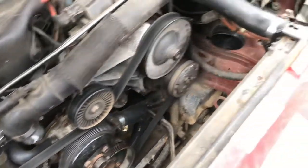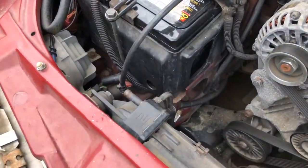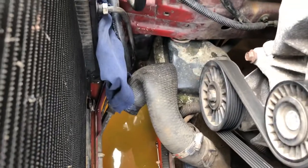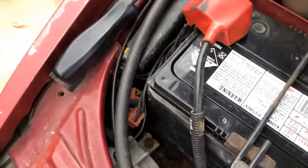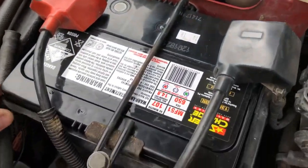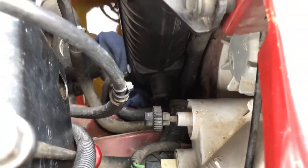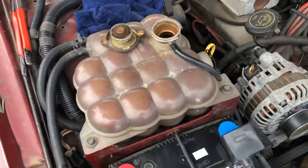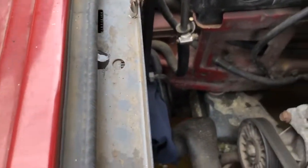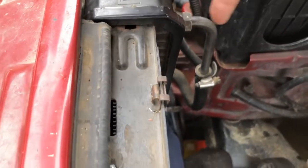Here's the new radiator. On the old radiator to disconnect: we've removed the bottom hose, then there's a small coolant line that runs up to the reservoir, and underneath there's a slightly larger one that also runs to the reservoir. Both of those have been removed. You've also got the coolant line for the auto transmission which needs to come off as well.